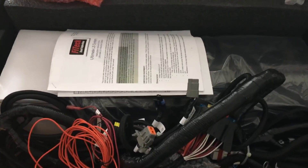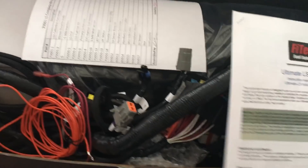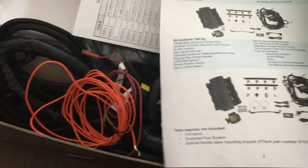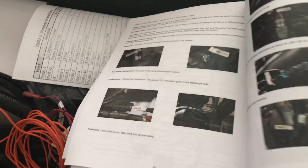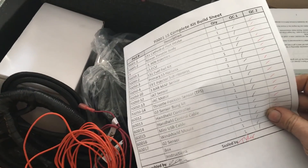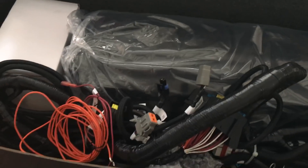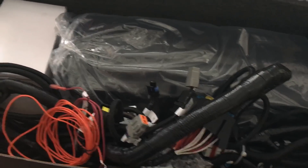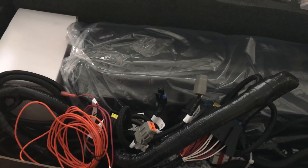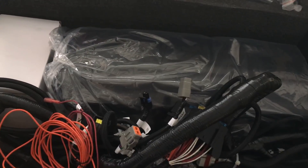Everything's very well packaged. Got the instruction booklet — everything's pretty much the same with colored pictures and detailed instructions. What I noticed is on the inventory sheet they took out the universal coil harness that came with the earlier design kits, probably because of people having problems with putting the coil harnesses on backwards. That happened to me in my previous video — I showed which wires are supposed to be for cylinder one and two so that the computer knows what cylinder to fire.